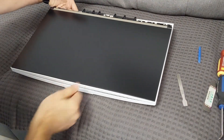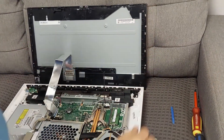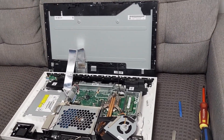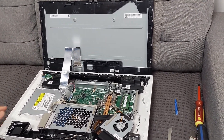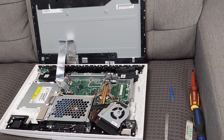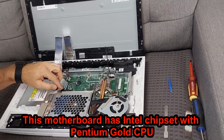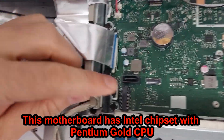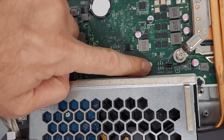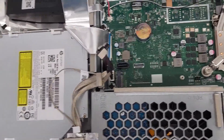Now I will do this. We have a back seat here. You see why it's useful to disassemble it on a sofa — you can put aside the screen display and you don't need to mess around with these cables. To proceed with SSD drive installation, you unpin this and there is a place for an SSD drive at this port. Once you install the SSD you need to screw it in with a special screw, and basically after that you need to reinstall Windows and it should be good.